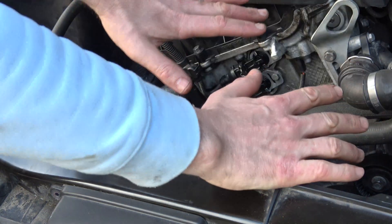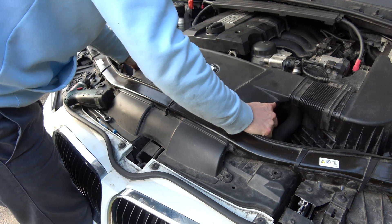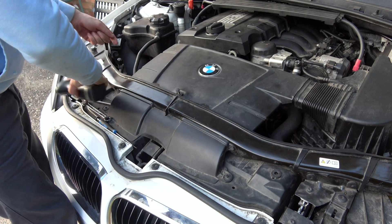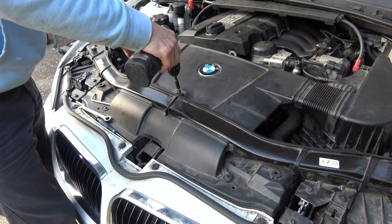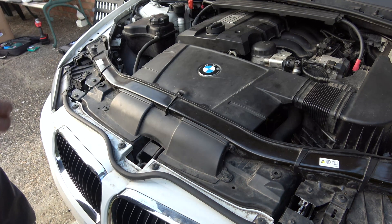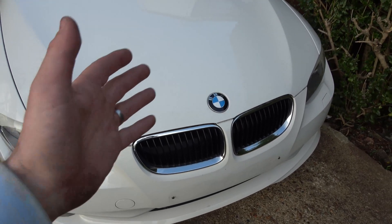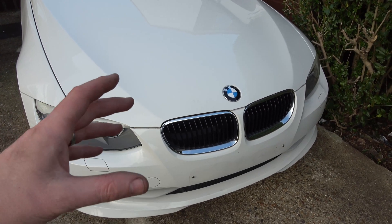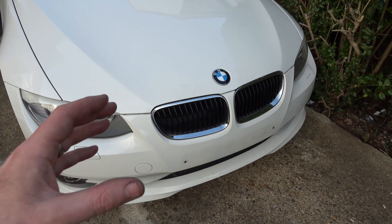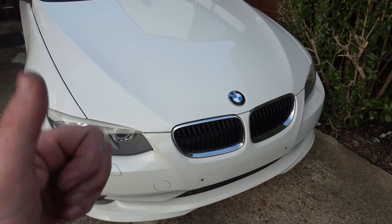So we're ready now to put this bit back on - just going to put this bit in first and then worry about the hose afterwards. Put the hose on - there we go. And we just need to do each of these Torx screws up now - we're only going into plastic so I'm just going to nip them. So there we have it - the exhaust camshaft sensor is harder to get to than the intake one but it is still possible, and by using a multimeter you can have an idea of whether it's doing something or not. If it's not doing anything then it might mean that that little position sensor has failed, in which case you can easily buy yourself another one and the problems may well go away. If this video has helped you out please give it a thumbs up - thanks for watching.